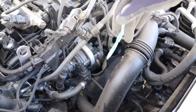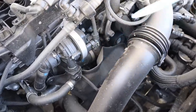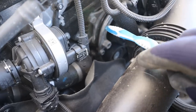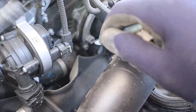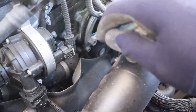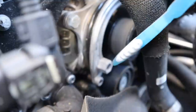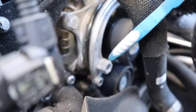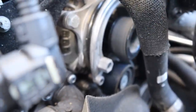Taking a look at the accessory belt drive, most of it is covered by the shield. The crankshaft below feeds the alternator at the top, and there's a tensioner — you put a socket on it and rotate to get the drive belt off once you clear the surrounding components. The cool thing about the alternator is the ring around it makes it part of the tensioner, so when you change the alternator the tensioner also comes out.